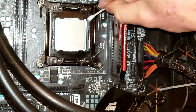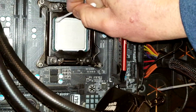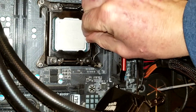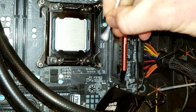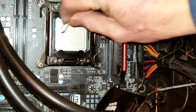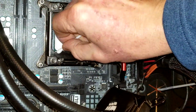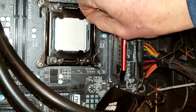Now we're going to use Q-tips. There is compound in the edges and right around the edge of the CPU that we need to clean out as well. First, use a dry Q-tip to get the big chunks out — you can see it right on the tip. Turn it around to the clean side. Q-tips are pretty cheap. Do the same on each side and the bottom, watching to make sure no big chunks fall down below.